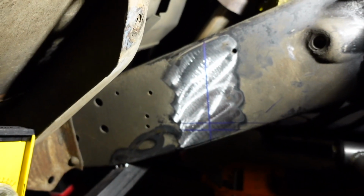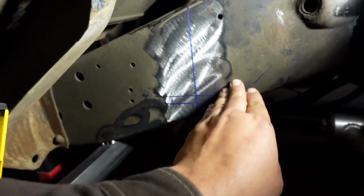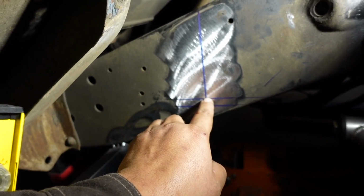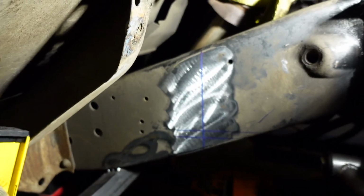And then we also have the engine and tranny, everything already hoisted with the front clip. So we're gonna cut from here down, and then from here to here is 1.5 inches. So this whole section's gonna move up 1.5 inches. So this corner is gonna meet up to this corner. We'll go ahead and clamp it. We'll take it all in place, make sure we square everything up, and then we're gonna do that to the front as well.